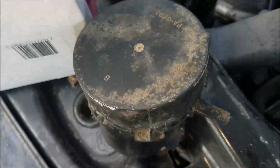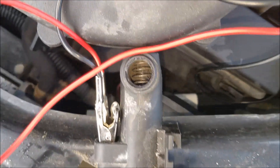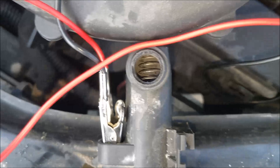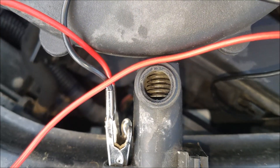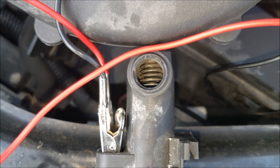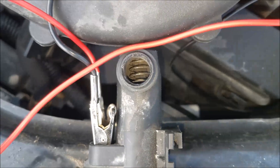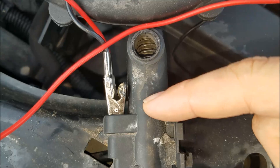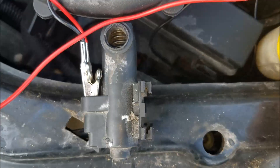This is not the one I replaced — this is a different General Motors one I had laying around that I disassembled. The valve is still working on this particular unit. When it wants to build pressure, the valve closes, and whenever it wants to burn those fuel vapors from the gas tank, it opens up.